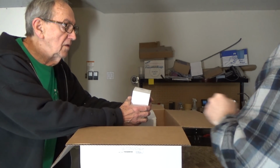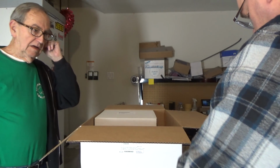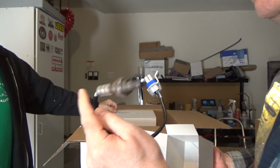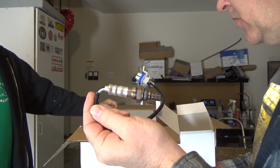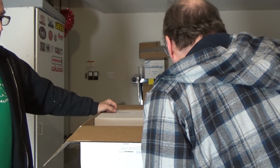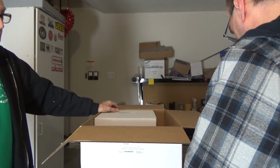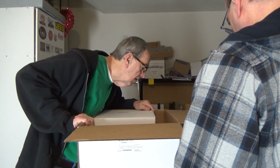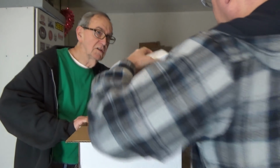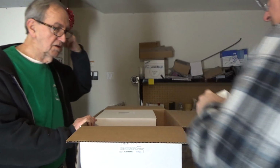Yeah. These are oxygen sensors, 4 of them here. So you have O2 sensors before and after the catalytic converters, 2 per side, so there should be 4 of those. Right. 1, 2, 3, 4. Yep. Well, they're different part numbers. Well, that's something to watch out for. Yeah. So this is this 265 and 266. Let's look at what the 266 is.